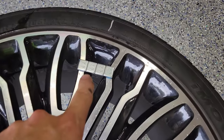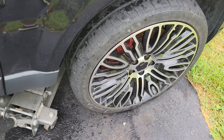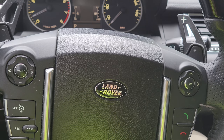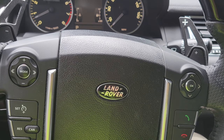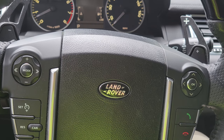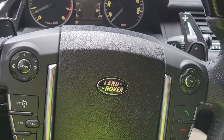Here's our second wheel — you'll see we have our weights on it and our chalk mark, and the bubble is perfectly centered. We're going to go ahead and put these weights on, throw them in the car, and take it for a test drive to see if it did anything good or bad. The wheels are both back on and torqued down. We're going to lower the vehicle and take this thing on a run. There is a storm that just came in, so I'm trying to wait for the rain to kick out so we can be safe. Just want to let you know there are two different types of vibrations: a vibration in your steering wheel, which is indicative of your front wheels, and a vibration coming through the floor through your butt or your feet, which is indicative of the rear wheels. I've only done the front wheels, so I don't suspect the rear wheel shake will be gone.